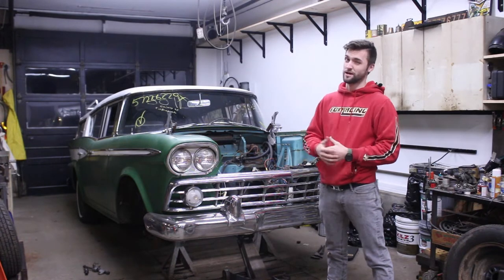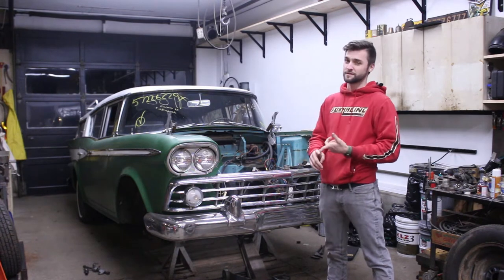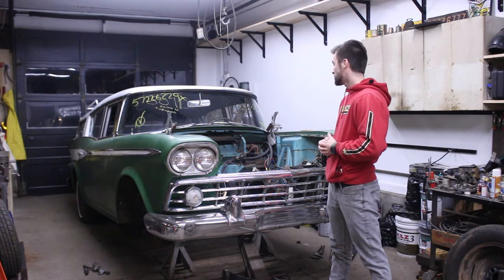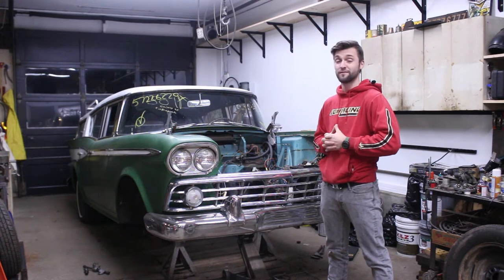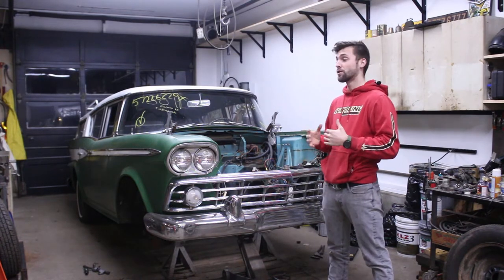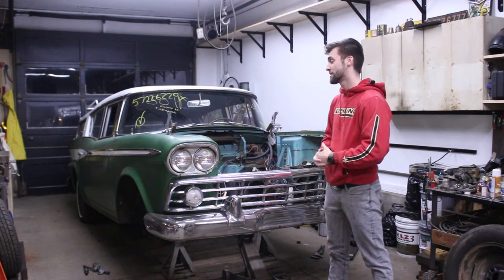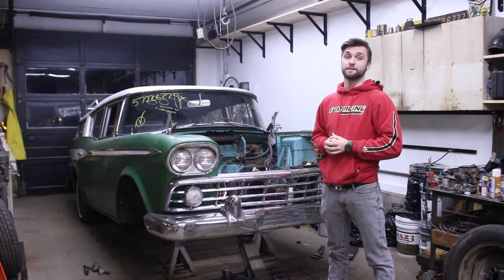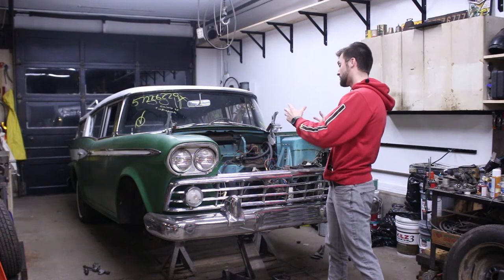There are definitely some challenges we're going to have to think about — boxing kind of a frame, new cross members, how do we beef up the unibody. It's going to need new front suspension, different transmission, modifying the tunnel. There's a lot of things going on to try to get this to work, and we've got to get it as low as possible. The 12-valve is a pretty tall motor, so we've got to be careful with the hood. The goal is to make it absolutely stealthy so nobody knows there's a 12-valve in it until they hear it.